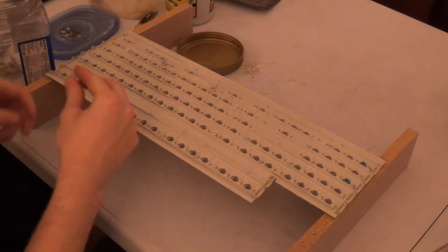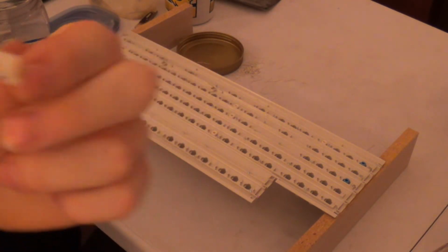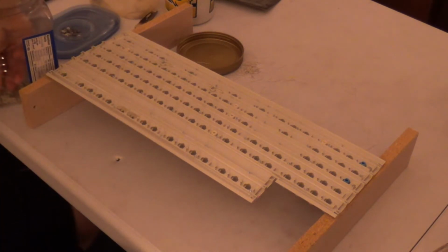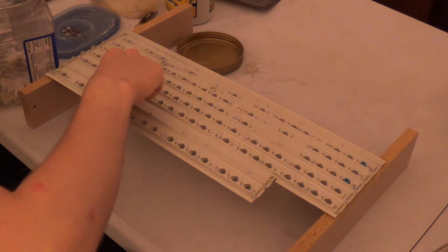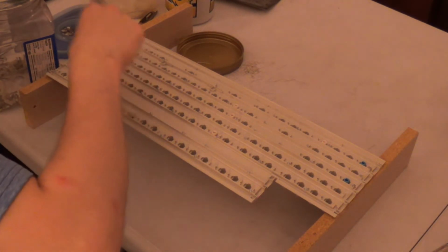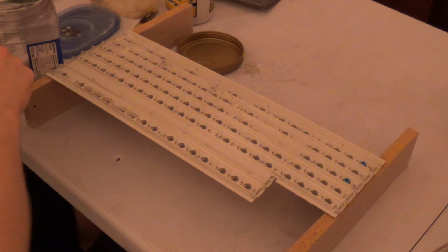Now, the way this works is the flapper on the buckling spring goes towards the front of the keyboard, the side of the keyboard with the space bar. And it's pretty simple. Spring goes down to the barrel plate, flapper goes towards the front of the keyboard. The little tabs sticking out of the flapper, flipper, thingy-doobly, or whatchamacallit, go into the slots on the barrel plate, and it becomes pretty self-explanatory from there.